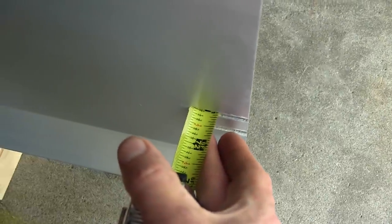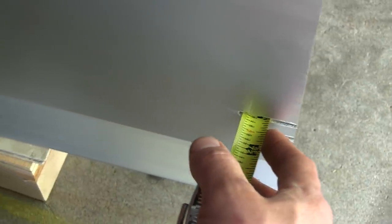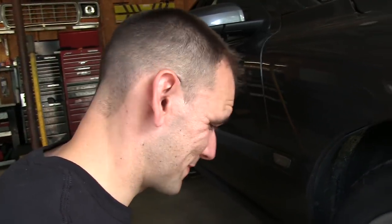All right. You may want to have something to write this with. Oh, Chris? Yes. Did we center your steering wheel? Probably a good time to mention. Yes. Before you start this process, you got to make sure the steering wheel is centered. Exactly centered. That's huge.